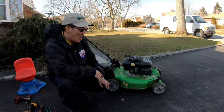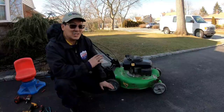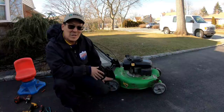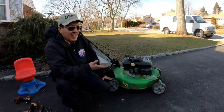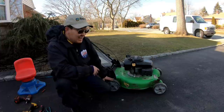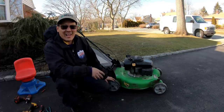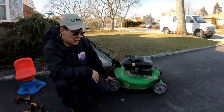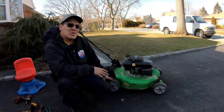It's very strong. That's the only real reason that I continued to try to fix it, because I felt that the gears in the transmission were very good. So self-propulsion is going to work well. You've got to try to figure it out, you know? If it was stripping or jiggly like that, then I say forget about it, because probably the worm gear inside was all trashed. But I could feel that this transmission was good.